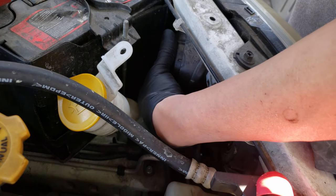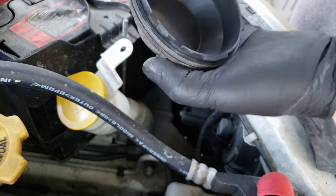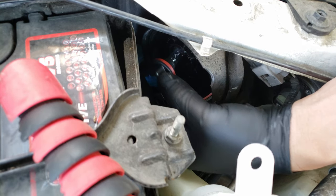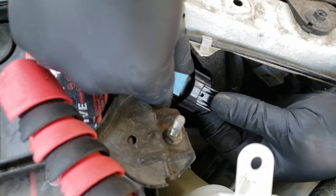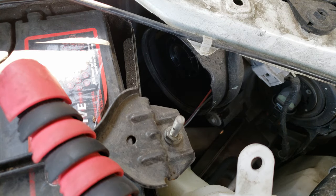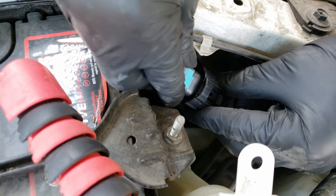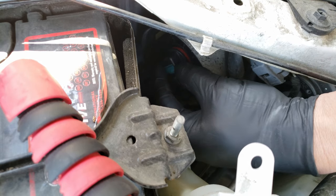As before, you'll want to rotate the cover counterclockwise a little till it comes off. We can now rotate the headlight bulb counterclockwise about 75 degrees and slide back on the bulb. To disconnect the connector just press down on this tab and separate the bulb from the connector. With the new bulb in hand, just slide in the connector till it clicks in place. Reinstall the new headlight bulb at about the same angle and rotate it clockwise till it clicks in place.